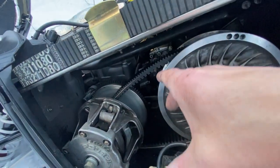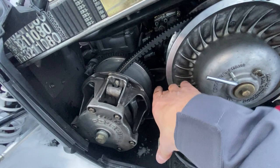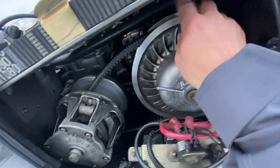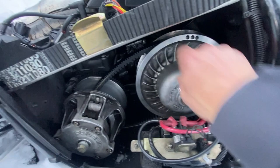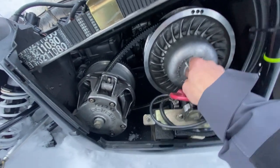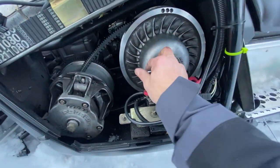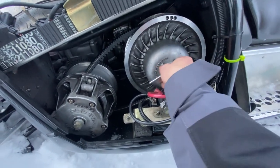I just put the new belt back in place. I put the bottom portion of the belt in first, sink it right here, go around that part, then spin that part and it starts sliding. Then flip it 90 degrees, put it above, roll it a little bit — it goes very easy once you have full tension. Then I just need to remove the L wrench, and after that I just need to spin the track to tighten it. Right now it's frozen so I should have freed that up before, but that's all you need.